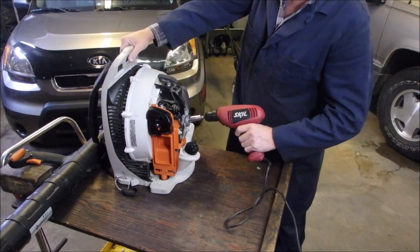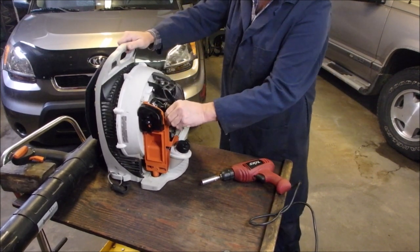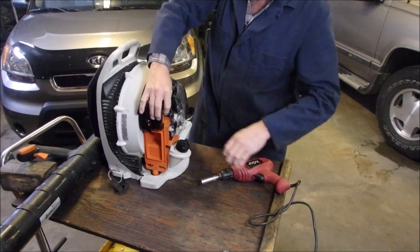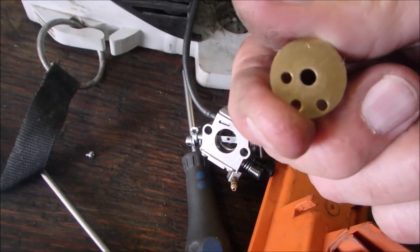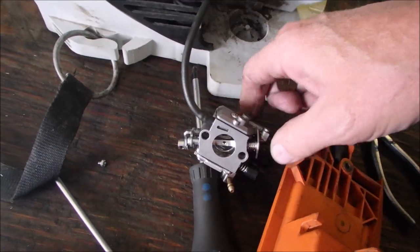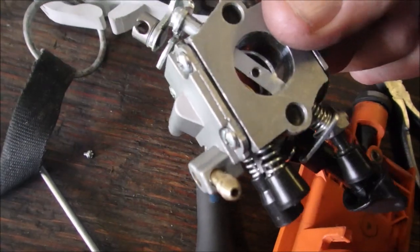Fired once, so. Okay, my friends, this carburetor has been diddled by humans. So, this butterfly was mounted like that. I think I'm going to mount it like that. There's the back. You can see the mark of the shaft on the back. Because I'm not getting any idle adjustment. I have to turn this all the way up. And I even tried a different screw on there to see if I could reach down. But it is opening it, right? It's just not opening it enough.